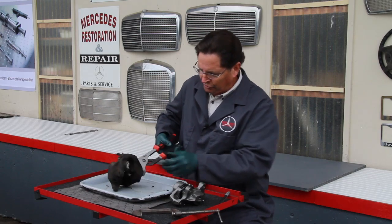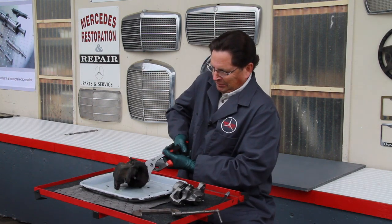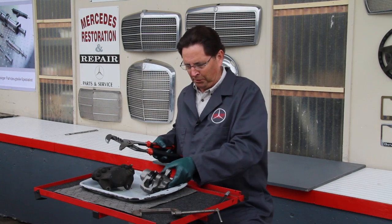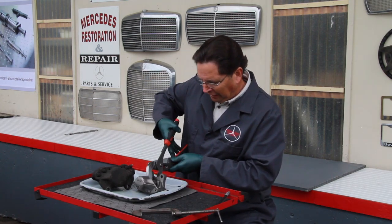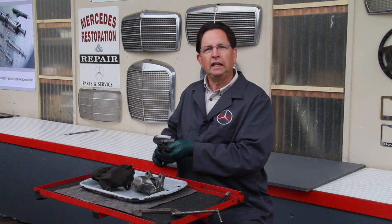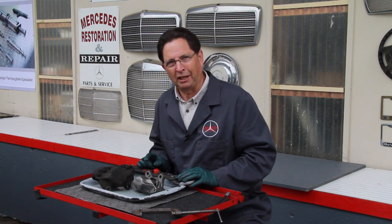Let's flip it over to the other side and try this one. This piston is moving a little bit and you can see brake fluid coming out of the fitting here, but it really should be moving in very easily. Let's compare it to a new or rebuilt caliper. After readjusting the plier, note how I just barely have to squeeze and that piston comes right in. If you find that your caliper is taking a lot of pressure to move it, then I recommend you either rebuild or replace it.